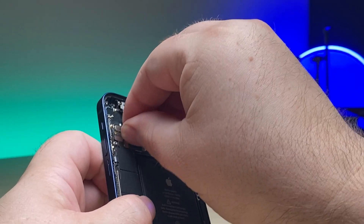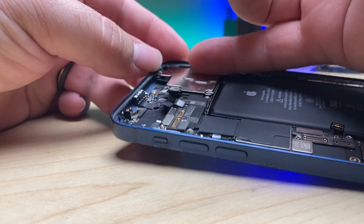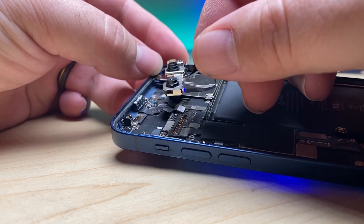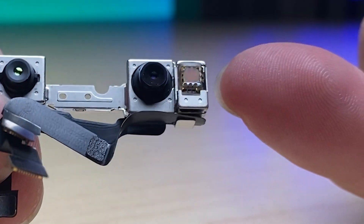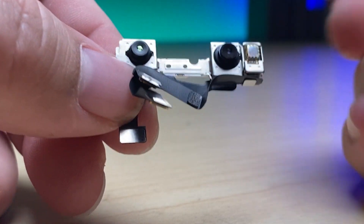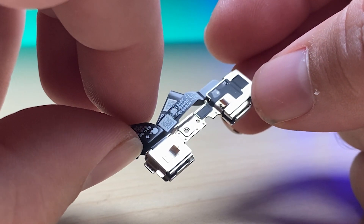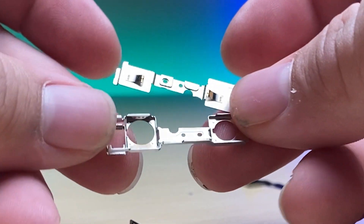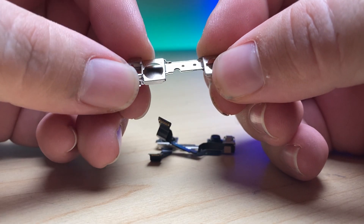The first thing I'm going to do is take apart the phone. I'll take the screen off, set the working camera aside, and go ahead and take the assembly out gently. You can remove the rear camera to make it a little bit easier, but it will come out if you're patient. Now we have to contend with the frame. The dot projector is glued into the frame, and the cameras as well are glued in, but they're mainly held together by a frame that is tack welded. The new camera does come with that frame and you can see it here in two pieces.